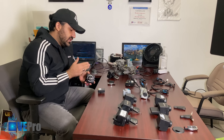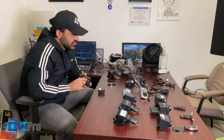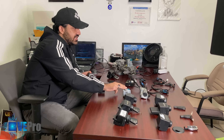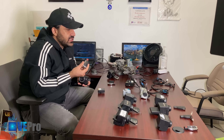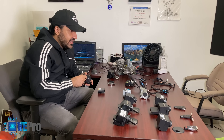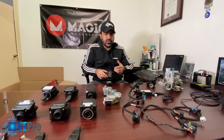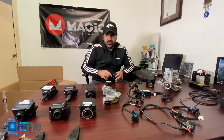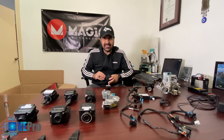If the key, EIS, or steering lock has an issue, you're not able to start and drive. A lot of times the first failure is between the key or the ESL. We have capabilities to read the key through the IR and diagnose where the problem lies. We can also test whether the steering lock or EIS is bad through the harnesses on the table — we set them up on the bench, fire up our software, test the different commands, and see if any control modules are not working as they should.